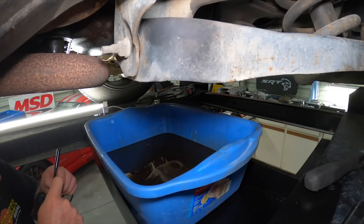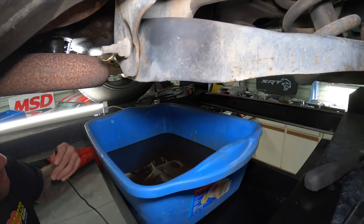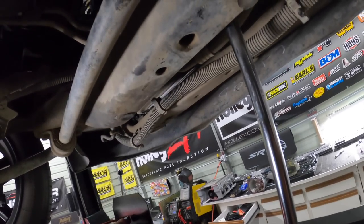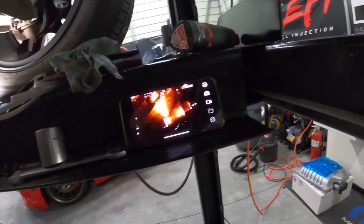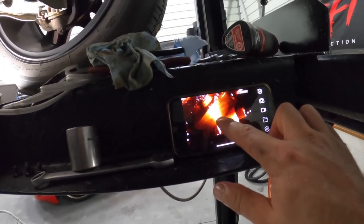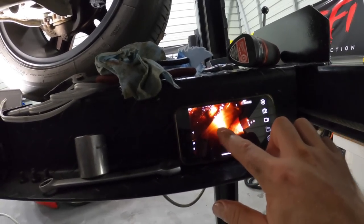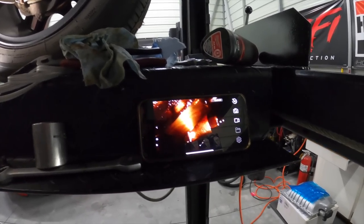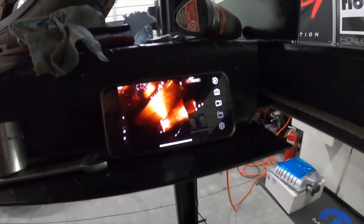I'm going to stick this camera in through the oil drain hole and start poking around to see what we can or can't see. I'm turning the crank and I found a couple of rods. It looks like the crank moves, but then one rod doesn't start moving right away. I can go back and forth with the crank — this rod is moving accordingly, but this other one looks like it's kind of not moving immediately with the crank. Could possibly be rod bearings — that's what some people have said. You'll also notice that inside this engine really does not look all that great — pretty old and tired inside.